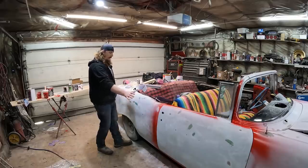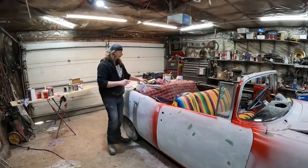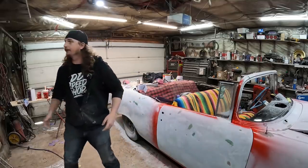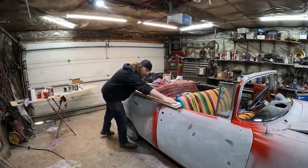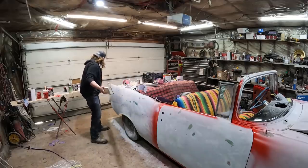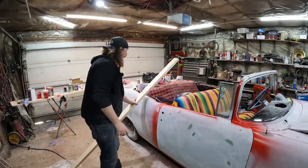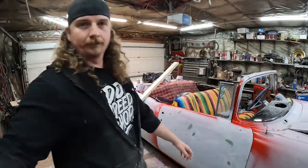Here's the way I want to do it — just because it's working for me. I want to get this car on the road as soon as possible, and I'd rather enjoy it as is, quicker. Now, I was thinking about these blocks — I was using a short block, that was wrong. We got a medium, we got a long block. Well, longer must be better. So I got the DD Speed Shop patent-pending eight-foot genuine Manitoba pine. I'm going to hot glue on a little 220, a little 320, a little 400, and go right out to maybe 500 or 600 in the back. As I run the whole block down the car, it'll slowly but surely finish itself. By the time I'm to the front of the car, it's ready for paint. Getting the car done is what I want to do. Build a hot rod, drive a hot rod, enjoy the hot rod.